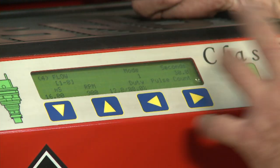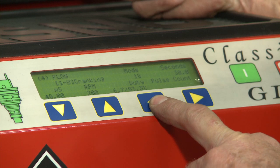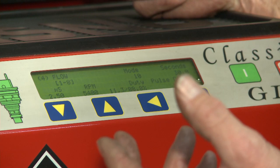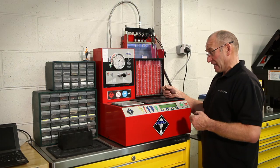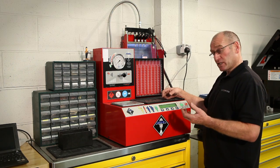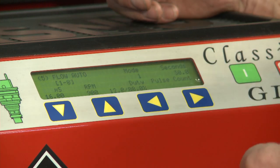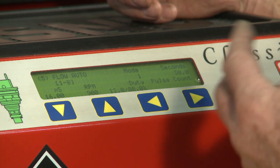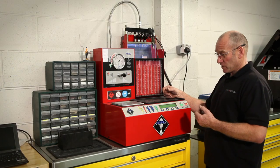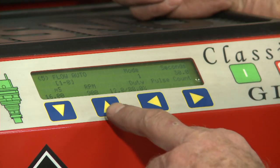Flow rates — we have a whole range of programs covering time and duty cycle. We can drive these injectors through an entire performance range, which is also very important. A fault can occur at just one delivery rate or engine speed, so we need to test them thoroughly through the entire range. We can have an automated test which selects a whole range of random control inputs, just to get an overall view of performance across an entire range, automatically set by the machine.